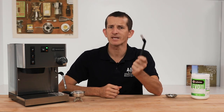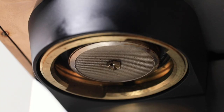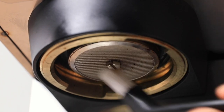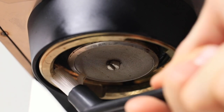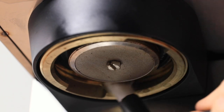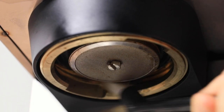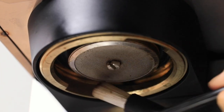Something that is easily done is using a plastic brush like this one, an old toothbrush, or even something small enough to scrub the inside of that group head where the seal sits around the filter screen. This also loosens up grind stuck in the filter for when you back flush the machine later on. You can also take a microfiber cloth to this area, which helps wipe away those oils more easily.